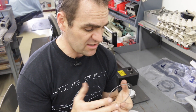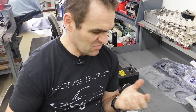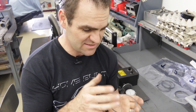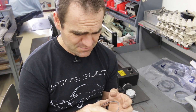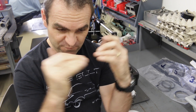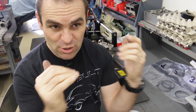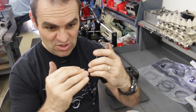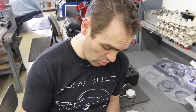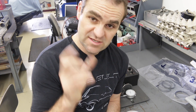One of the things about gapping rings — I'm a novice to all this, and when I first heard you needed a gap in the rings I thought, why would you want any gap, wouldn't you want them solid? That's definitely a no, because as the engine gets hot the rings expand and come around to touch. You want them close enough that they'll touch when hot, but not so close that they start pushing out against the cylinder wall. So you want to take your time, grind them, and get the gaps right at the tolerances you want.